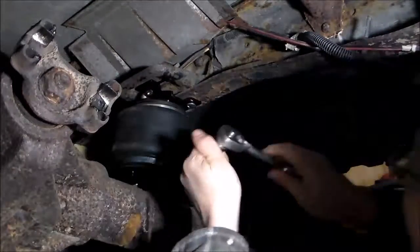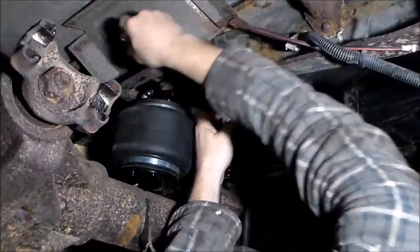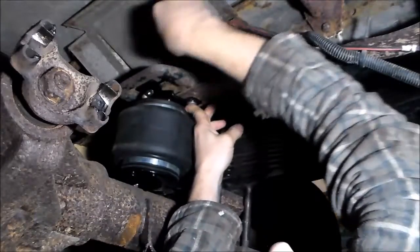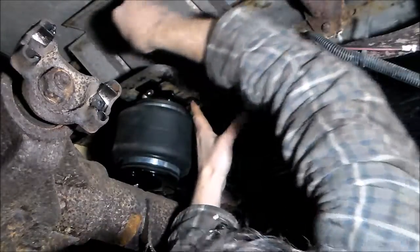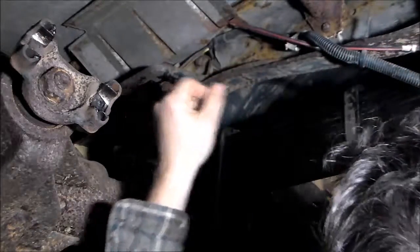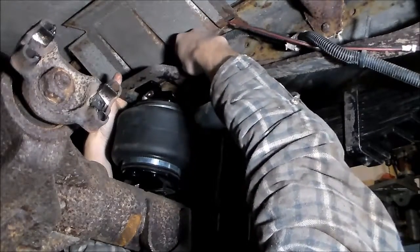Okay, we got a shallow well socket here. Just hold up on the carriage bolt to hold it in the slot there. The nut has a nylon insert in it so it's locking — it takes a little bit more force to tighten up. We're not going to tighten it up quite all the way yet. I want to get everything else hooked up and started first.